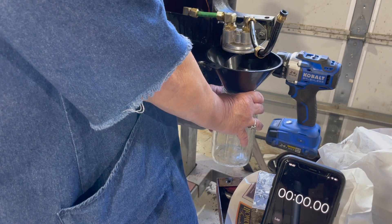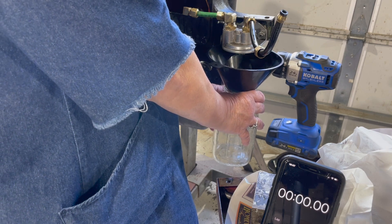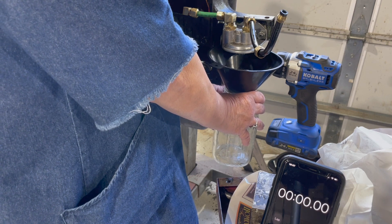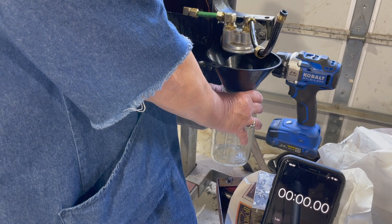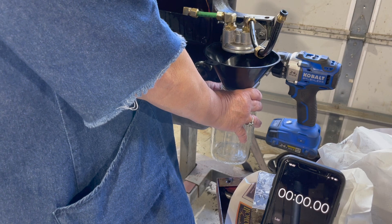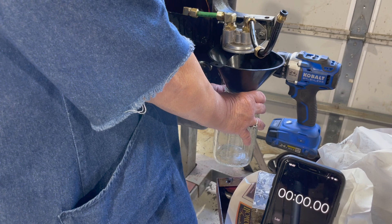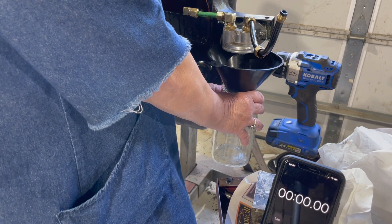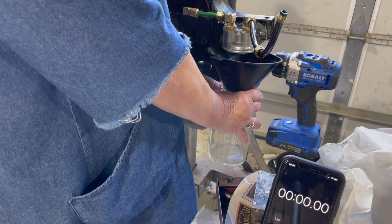No filter, just coming out into the valve gallery. I tried to figure out a way to catch it coming out of the timing chamber, but it was just so hard to do, so this should give us a pretty good idea of the flow rate. Running it at 525 — or 550 RPM rather — that should be 1100 at the crankshaft. So we're going to see how fast it'll pump a quart of oil.